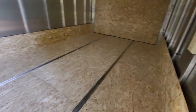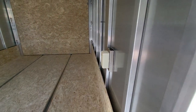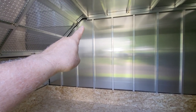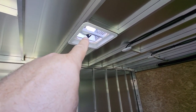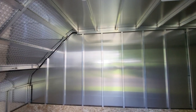The sleds will be stored in here most of the time. There's a 110 plug — plug your extension cord here and that gives you 120 volts right inside. I could use this for camping, but also if I want to plug in chargers and run them to my snowmobiles, I can run two chargers to my sleds. One of the choices when you're looking at this trailer is vents — either up in the front corners or a vent on the top. I chose the top vent, which is opened and closed by a handle, because when this gets filled with exhaust smoke, it needs to exit, and smoke rises.